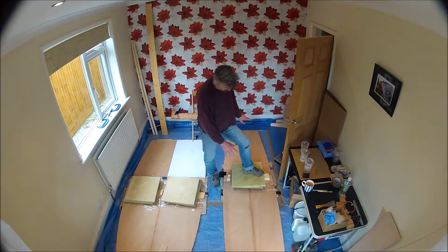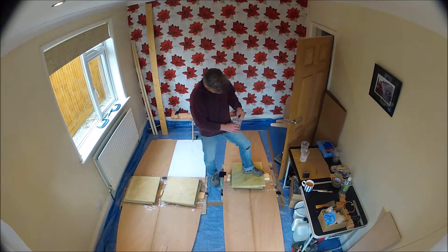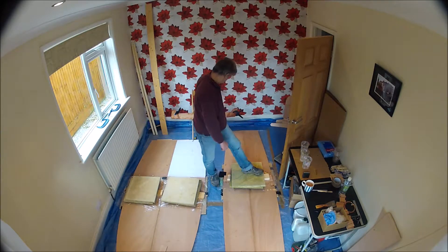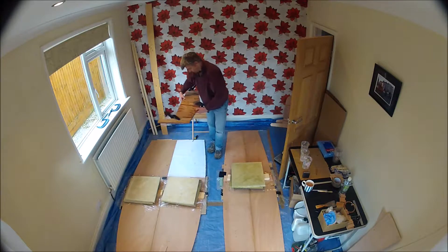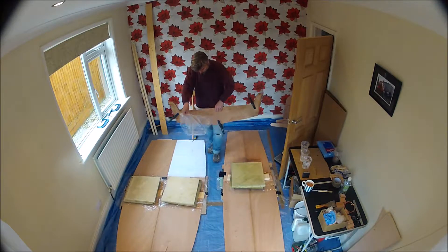I'm not going to touch that one this morning. And this one is from the bulkheads - yeah, that's quite rubbery as well. So those still need a bit of time to finish curing. I'm going to leave the bulkhead doublers and the sides as they are, not going to touch them at all. My experience shows that's not a good idea.